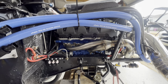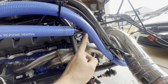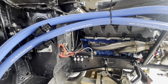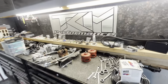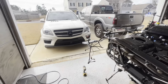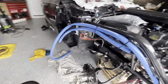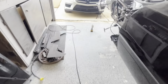No matter how much I don't want to go up like this, we're going to have to. I'm going to look into possibly getting a heat sheet, blanket, or shield sleeve to go from here all the way to there. We're going to go ahead and cover it with a sleeve for now, and what that will allow us to do is - until I get the proper heat sleeve - this will show us if it's getting too hot. That will start melting and tell you that you're probably getting too hot, and then it's not going to work as efficiently because you're heating up the cooler water you're trying to get back into the engine. We want to definitely put some kind of heat protective sleeve over that if possible.